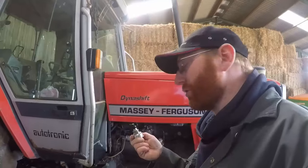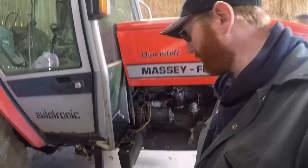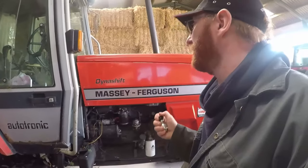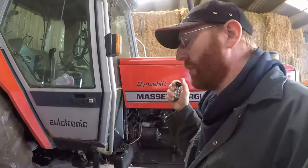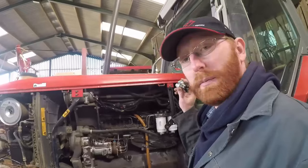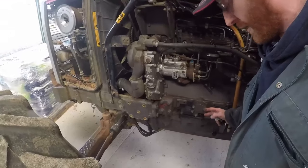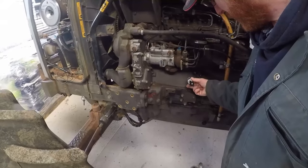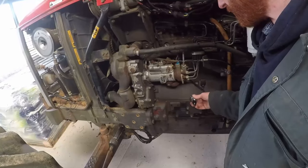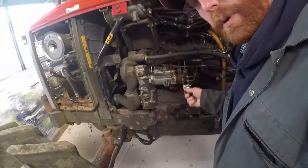I've been thinking for a little while about where is the most sensible place to install this switch. The first obvious place was this side of the engine — so when you start up you check your oil and then just turn the switch on, ready to go. That's fine for starting up but it's the wrong side for getting out, and you're highly likely to forget to turn it off. So I want to mount the switch somewhere below the bonnet or panel line but protected by it. I think the best thing to do is make a bracket off these two bolts here to bring the switch out here, with wires running behind. It will be below the panels but should keep the worst of the weather off it and still be easy to reach.